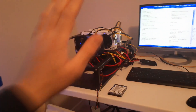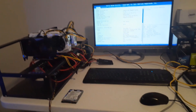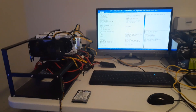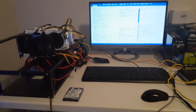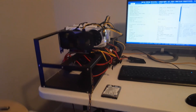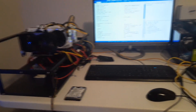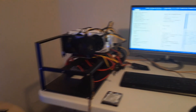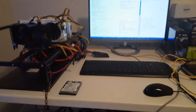I'm putting Windows OS onto a USB here, then we're going to boot from it and try a fresh install to see if it detects any of the hard drives. I'm going to pause the recording while the USB is being made with the Rufus application, and once that's done we'll continue with the process.